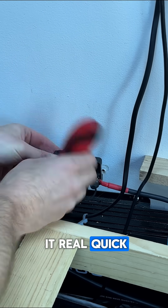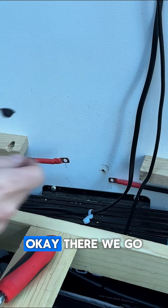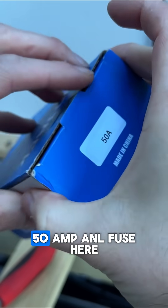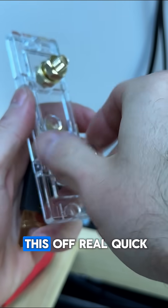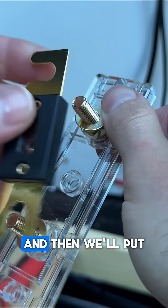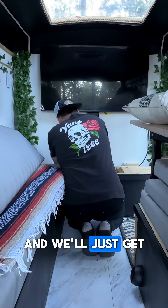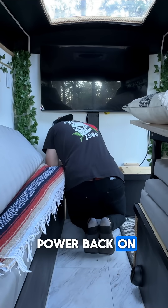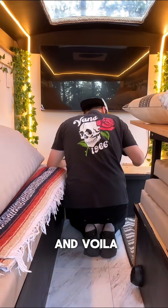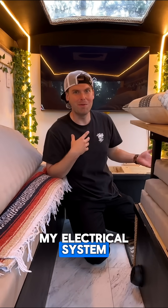The first thing I'm going to do is just disconnect it real quick. We'll take off this bolt here, and now we can get this one. There we go. Now we'll go ahead and install this 50A ANL fuse — it's just going to look exactly the same as the other one. We'll take this off, and then we'll put the fuse blade in. Get that on right there, tighten that down. That looks pretty good, so we'll turn the power back on. Put that switch there — and voila, we have light. Now I have the correct protection for my electrical system.